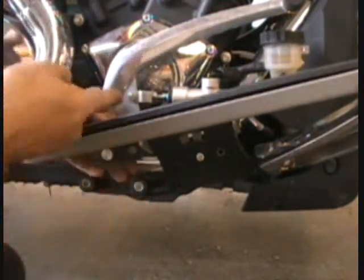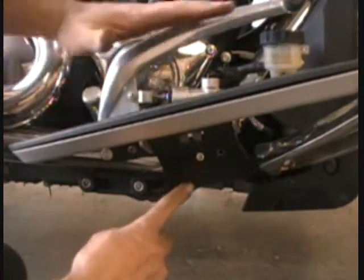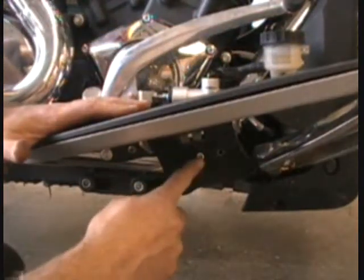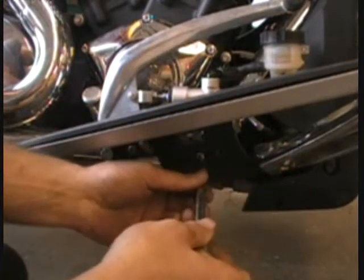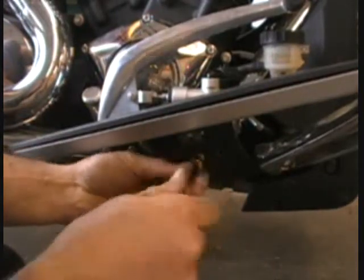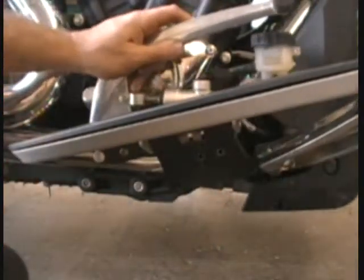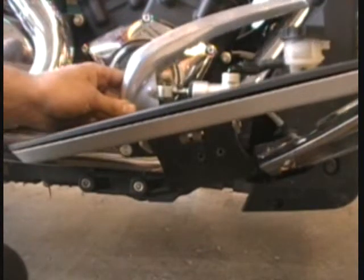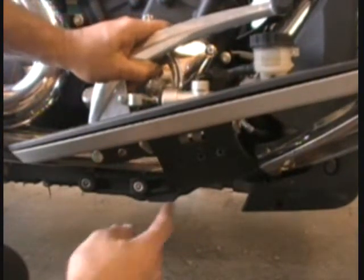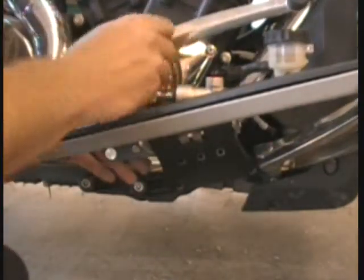You're probably not going to be able to get the bolt pushed through to the other side. Now, this bolt right here is what adjusts your pedal's front to back position. Most of you probably know that, but you can adjust your whole pedal assembly forward or backwards by putting this bolt in a different hole. So you want to take that bolt out — that's a five millimeter allen — because that's going to let you slide your pedal assembly forwards and back. This gets everything loose so we can work on taking the main bolt out.